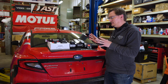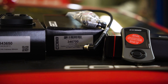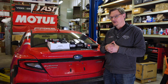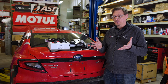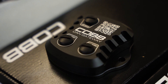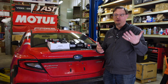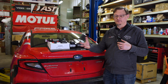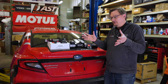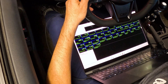Let's dive into it. We've been waiting for this FlexFuel kit. We've heard that it was close and now it's finally at hand. We can now put FlexFuel on this car. What is FlexFuel? The very Cliff Notes version: this allows the car to run pump gas or E85 ethanol-based fuel in any combination thereof. It doesn't have to be all or nothing, because with the FlexFuel sensor and system, the car knows exactly what the fuel content is and adapts to that.